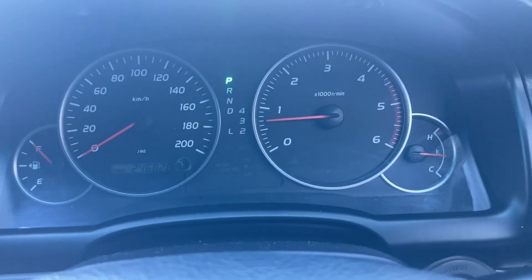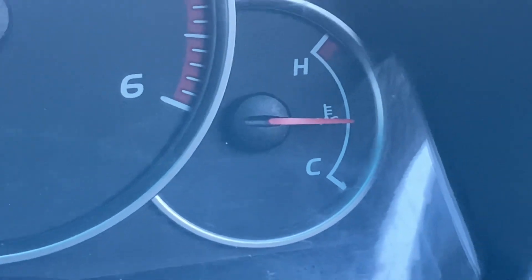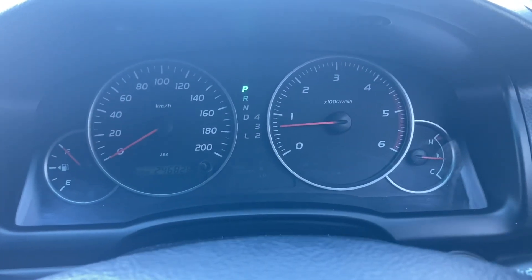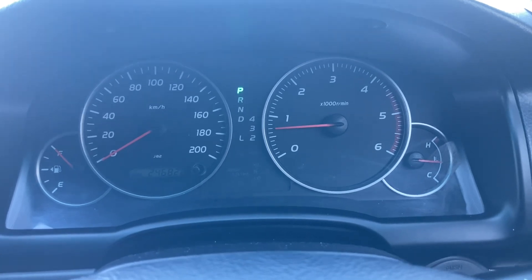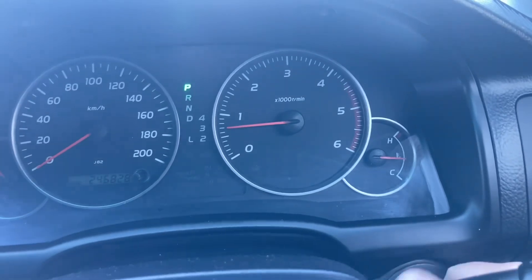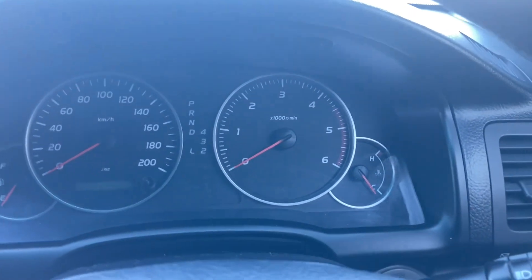This car's got a new thermostat in it, so I've got a good idea it's going to be about 81 to 83 degrees right now because I've been sitting here idling long enough. Try and avoid idle time where you can, but we're just doing a bit of chatting and showing you a few things. If you're sitting here a long time, you would just switch the engine off.